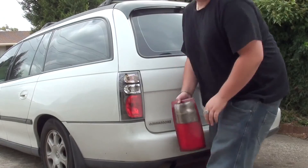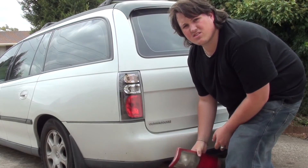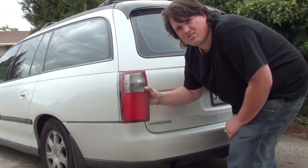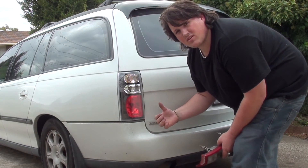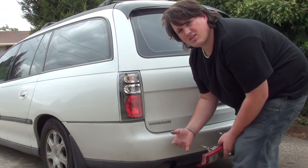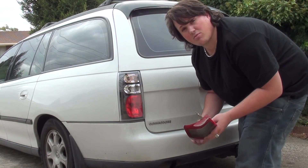And there you are. So what we've done is effectively changed from old light to new light. Hopefully now you've been able to change your car from this to this. Now don't forget: one, you have to remove the grill from the inside. Two, remove the four nuts. Three, take out the light and then gently remove the light globes — which is also a good chance to actually replace the light globes as well.